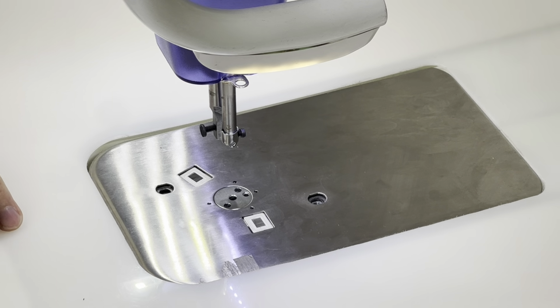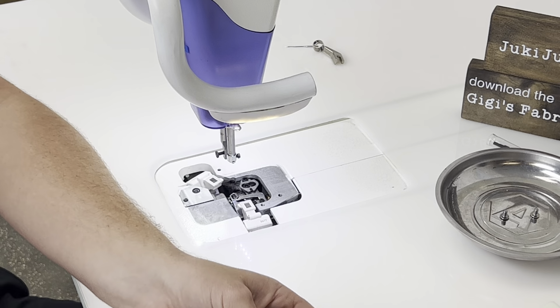And once you get it up, you can kind of just slide it out. You want to be pretty cautious and gentle when you're doing this. You don't want to scratch these sensors or whack these sensors in any way where they're going to shift around and move. But this is the stitch plate here. You can go ahead and just lightly cleaning swab this down, get any dust or anything like that, and usually it's not very dirty. So as you can see, it's not very dirty today.